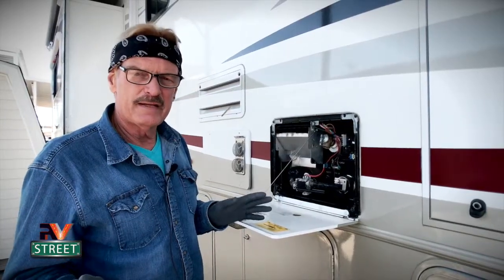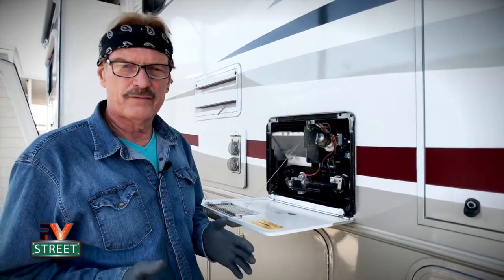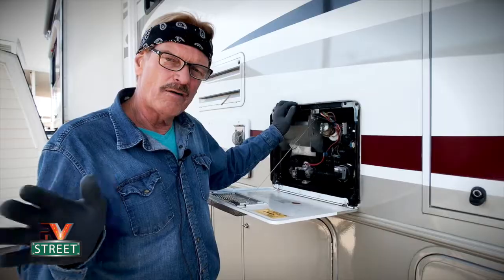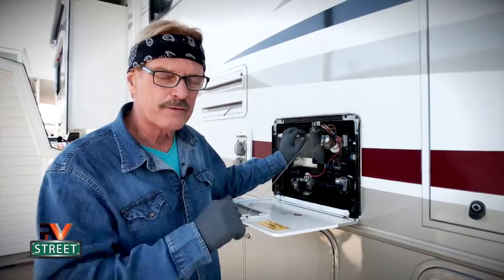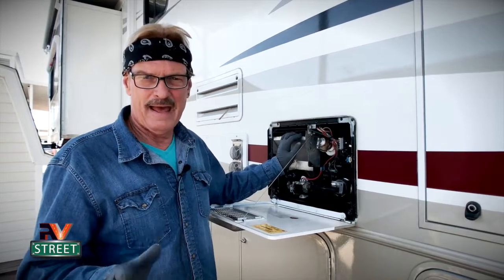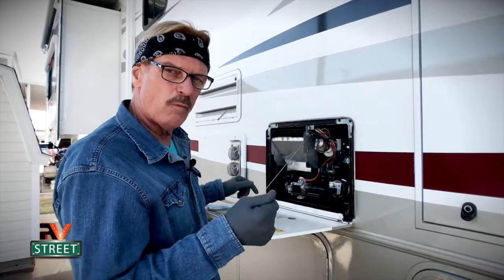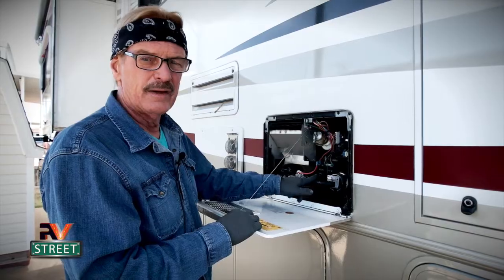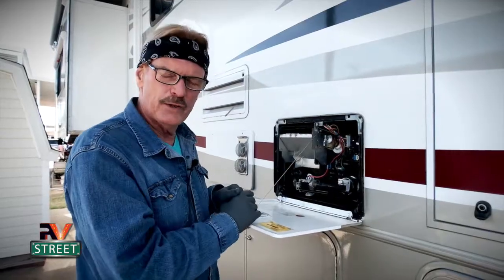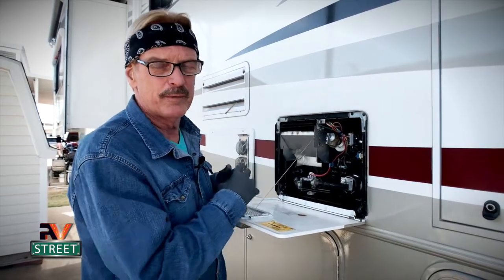As I've mentioned in other videos, a water softener is very important, and we have one. If you're a full-timer traveling all year round with an Atwood and a water softener, twice a year flushing is fine. If you do not have a water softener, you need to do it more often, because mineral deposits from hard water will accumulate inside your water heater and throughout the RV. Not flushing with vinegar will greatly reduce the lifespan of the water heater and the heating element. This is a very important PM item.